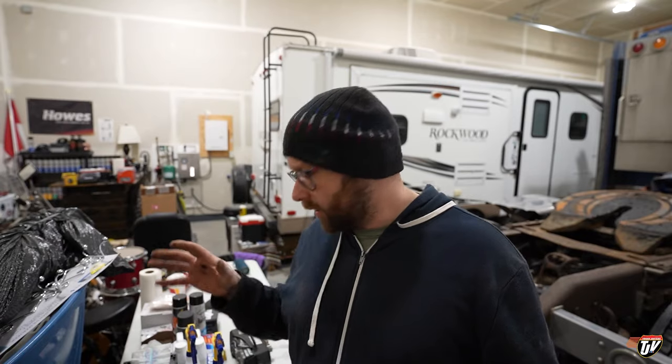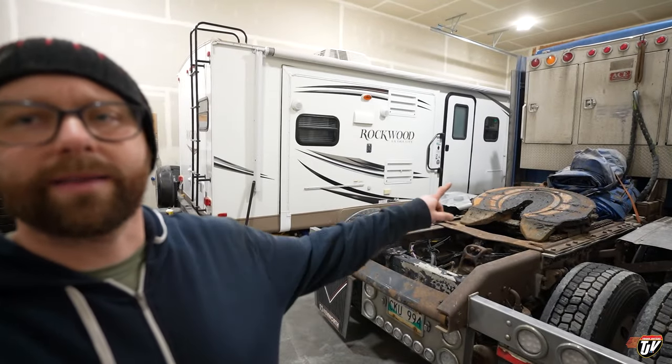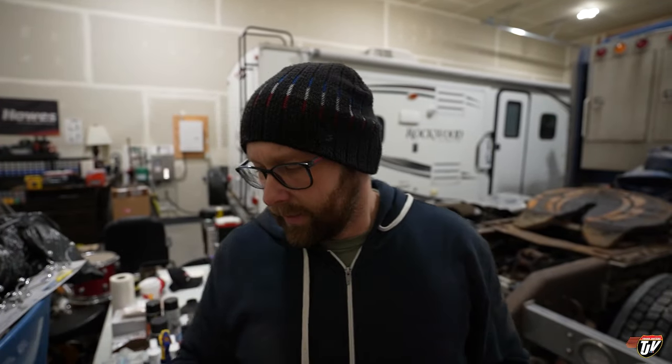Every time that truck stops, turn it off. I also have one of these. It's a little bit different, but it's the same idea. It heats up the fluids in my engine. That's in this little white box. Oh, you can't see it. Behind my tarps back there, there's a little white box. That's where I keep that one. But that's an engine heater. So my engine stays warm and my cab stays warm and I don't have to idle the truck. It's cheaper to do that than to rebuild an engine.